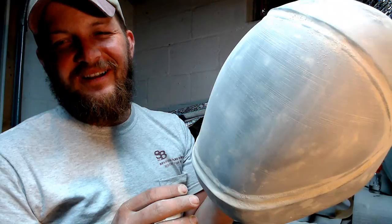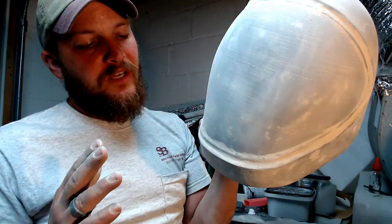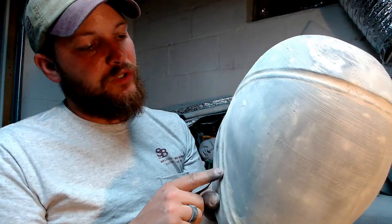I'm not even sure, Glenn. But yeah, so this will stay thick. When I sanded it, if any bigger chunks would have come out, or it didn't seal up properly, especially as I held it up to the blower and sucked the dust off of it, every now and then what you'll see is you'll start to get some pits where you had air bubbles in the filler primer.